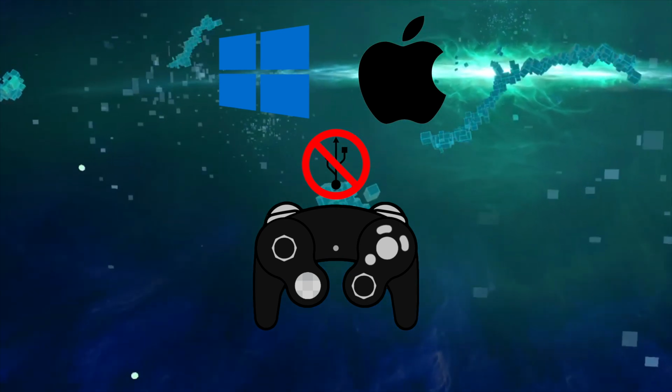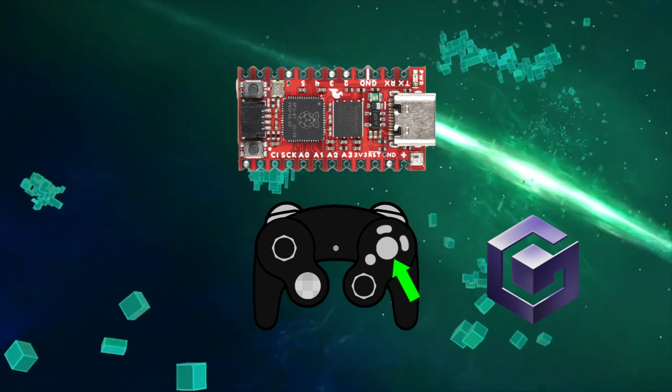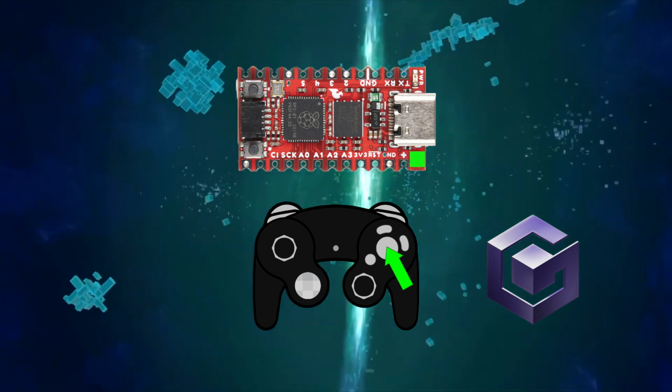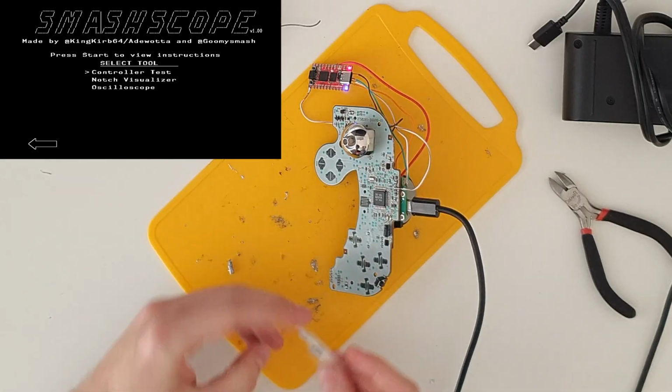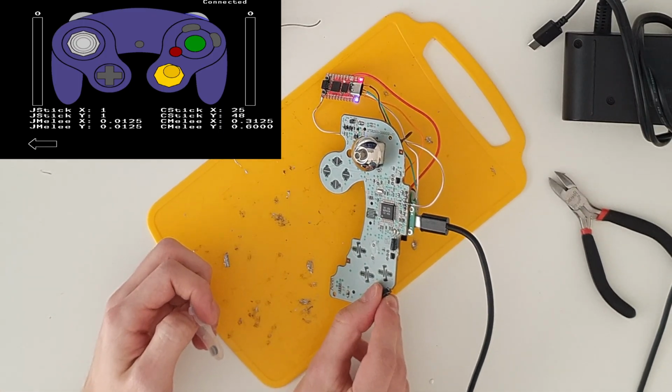The board couldn't read the controller inputs at all. I modified the firmware so that the LED built on the board will change color by pressing the A or B button. It worked when the controller was in GameCube mode, but not in USB mode. This was very weird. It could not have been a wiring problem since the controller works and the board gets recognized and can even send inputs.